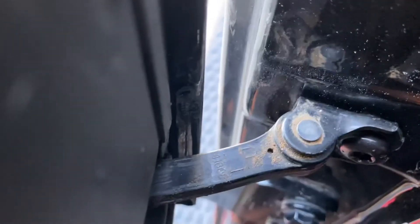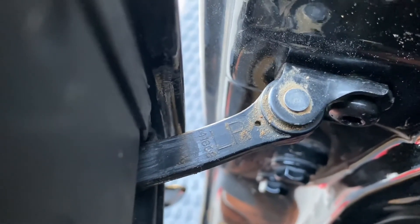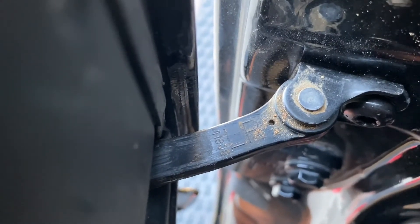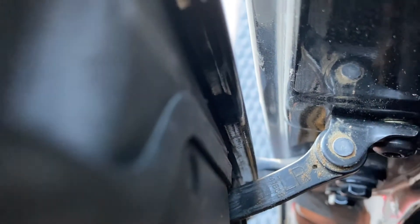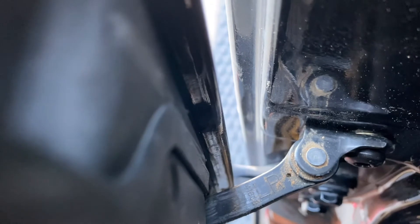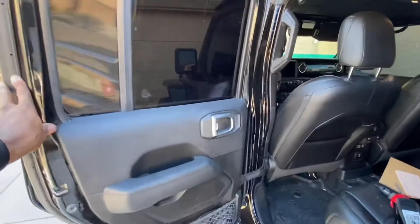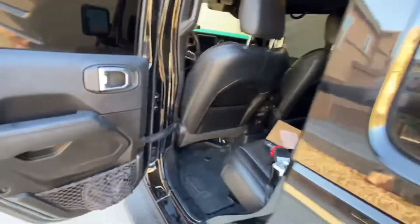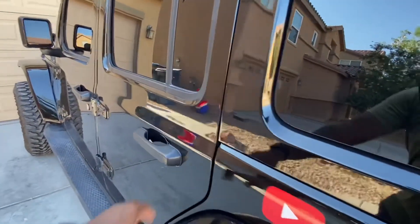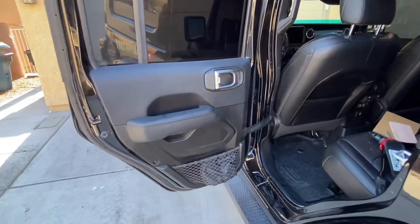It might have a little bit more of a gap than the factory one did, but it's just a check strap, so it's going to work. There's a little gap where it kind of looks like a washer, but it's actually the head of the rivet. Right in there. Let's get the Jeep turned around so I'm on the right incline and we'll test it out. It's been held open. Works perfect — just like new.